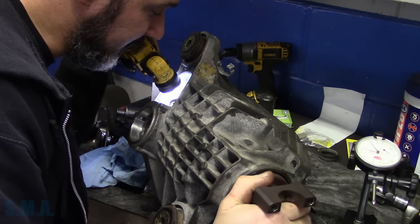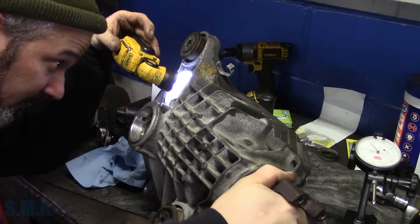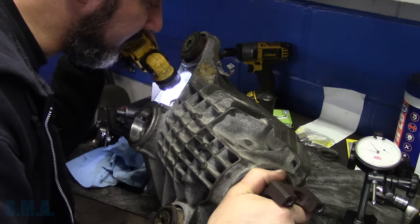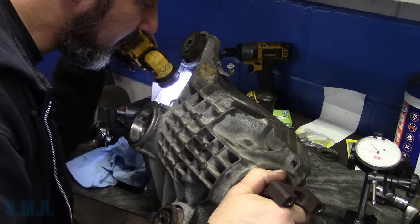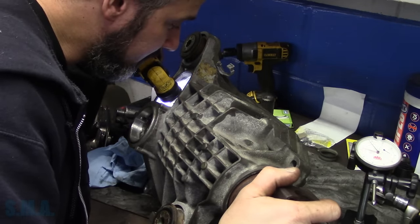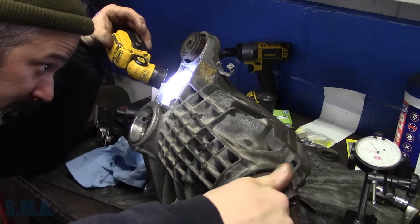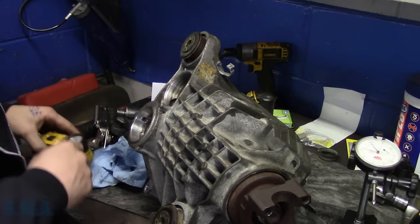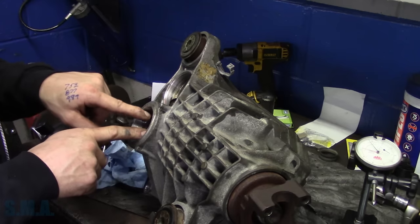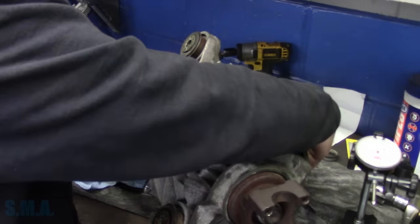I'm curious to know, because it's a worn gear set, if we induced a little bit of backlash into it, if that would be beneficial to us. And I think that's what I'm going to do. I'm gonna bend my tab back up, please don't break, and then I'm gonna come back. We're gonna give it just like 3/1000ths, so I'm gonna do that, back the right side off,